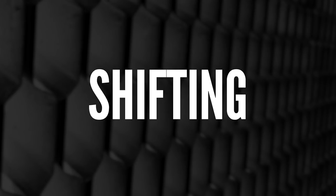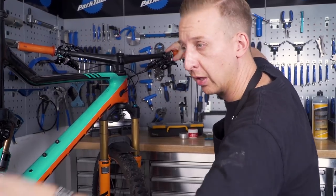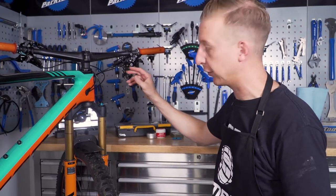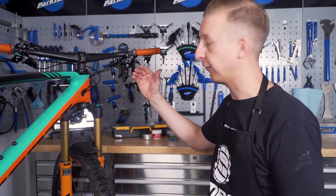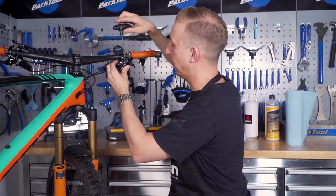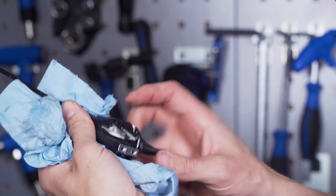Next up at the front of the bike, you want to make sure all your controls in your cockpit are safe, and that your transmission and gears are working nicely. I'm just going to run the bike through the gears — my shifter actually feels really nice and smooth and indexing is still good. However, it's very common after a winter's riding that your gear shifting is quite stiff, and that's down to one of two things: either water and muck has got into the outer housing, corroding the inner cable or causing additional friction, or there's friction inside the shifter itself. I'm still going to put some thin spray grease on the inside of the shifter, because it helps keep rain from getting into that cable in the first place and forms a really good barrier without congealing or getting in the way of the shifter action.